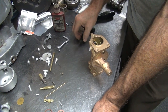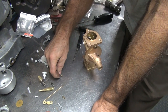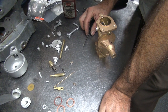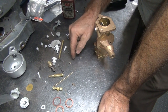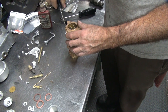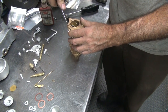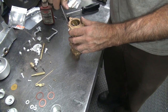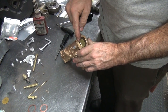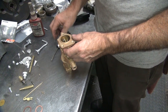Let's try the next one. That appears to be the same problem — so that's the next one we can't use either. Which one looks the best? That one. Okay, this one goes up here. There it goes. Okay, that plugs up the transfer idle passage and plugs up the end of it, so now it only breathes through here. The gasket doesn't necessarily seal the outside edge — it could leak, that's why you need more than a gasket there.